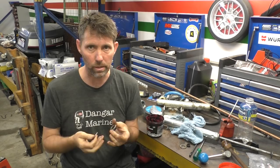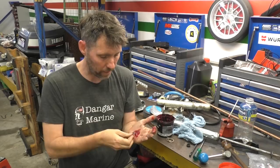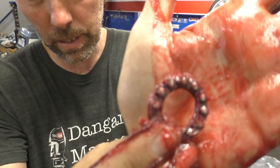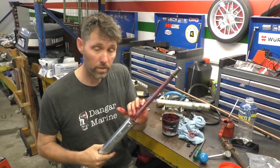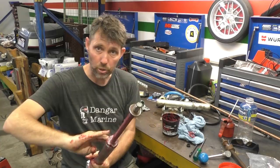With this somewhat cheap and nasty bearing, I'm just going to push the grease right through until it comes out the other side — same way you sort of pack a normal bearing. So this is what the bearing looks like now — just the grease pushed right in between the ball bearings and the retainer and the cage. Messy but functionally better. Now while I've got grease all over my hands I'm just going to wipe the excess onto this thread and the shaft. So this thread seizing is what's been giving us trouble winding the extension up and down, and then corrosion around the main part here is what gives us trouble with the jockey wheel spinning when you're pushing the boat around the yard.